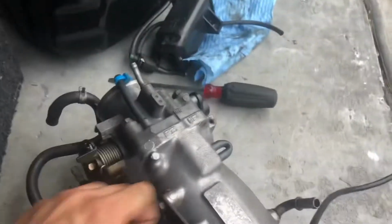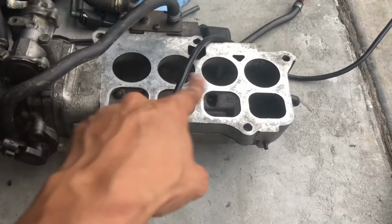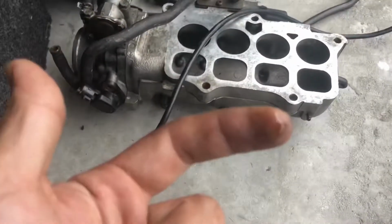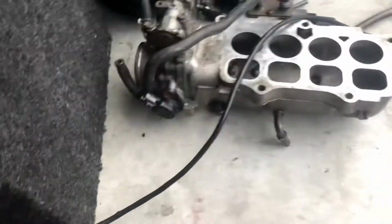Back on our upper portion of our intake, same deal. We're just gonna cut the whole centerpiece out and pretty much just clean up all the inside. Ew, there's oil on there. But yeah, so we're just gonna clean up all the inside, get rid of all the casting imperfections, and just drop our plate. Get rid of all the casting imperfections with our Dremel, clean it up, port and polish. You guys know the drill.